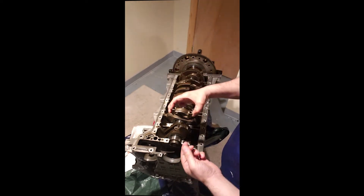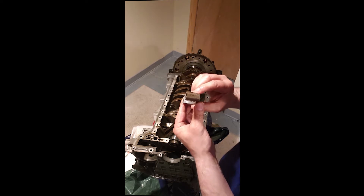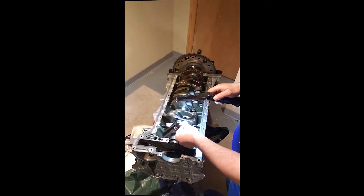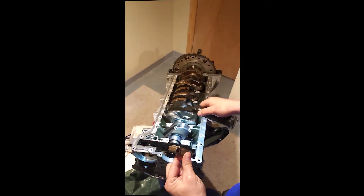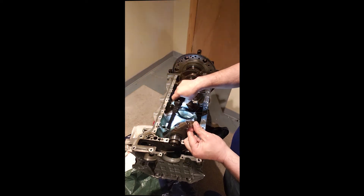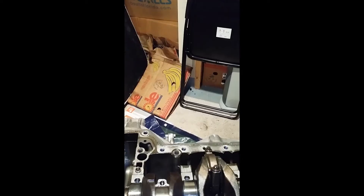This is how it looks. So the numbers, the marks — where they go — should be on one side. The numbers should be on one side of the caps and on the connecting rods, which is the side we're going to call the driver side. And then on the engine, on the cups, there's a number — a matching number.